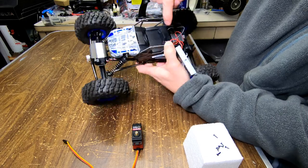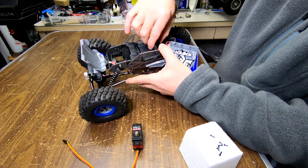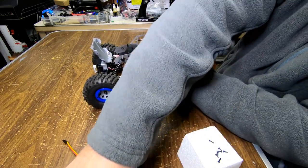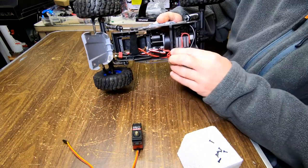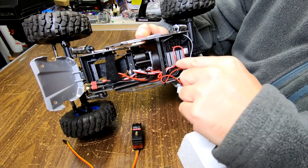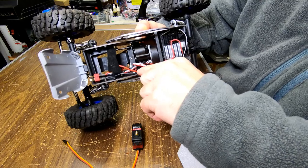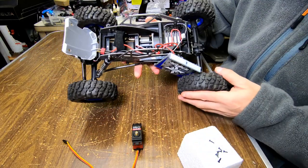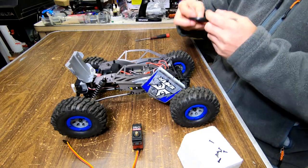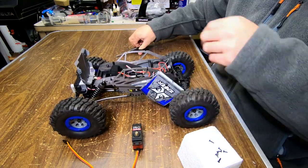Then you got a screw here, and then a screw on the side here, and on the opposite side there, and you just pull this interior out. And then you'll see inside there they have a cluster of wires with a normal servo connector jumped from this funky wire that looks different. And then you got to take this apart — that's how you wire your servo in. I'm going to do that right now; I'm just going to cut the little tie wrap on it.